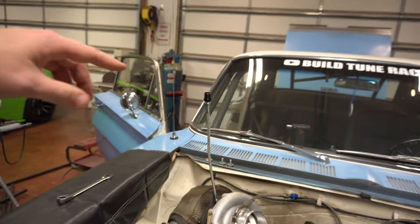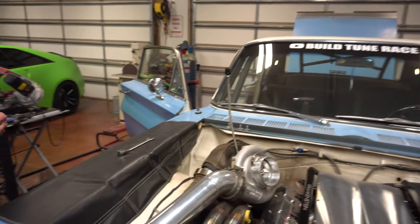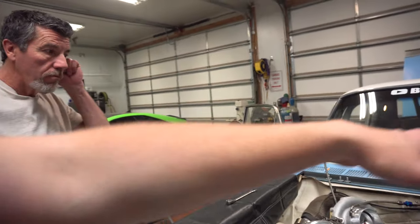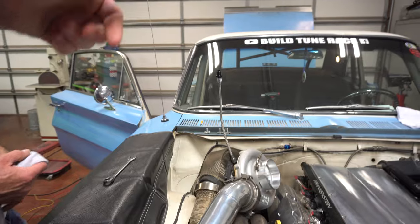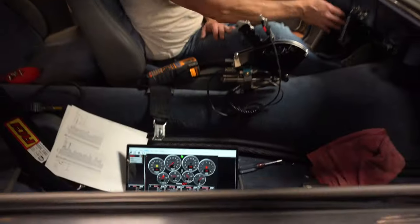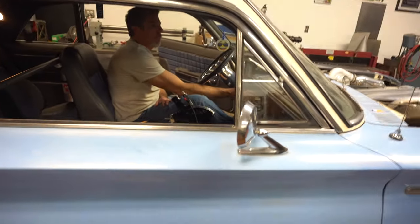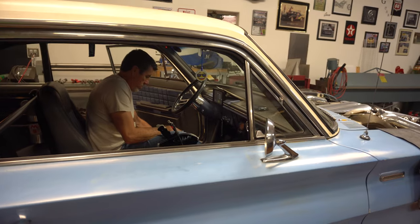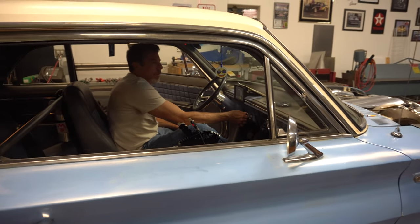I was wondering what the lines were that he had on here. He set these up to fill it up with some oil so you weren't dry running the scavenge pump when we first fired, when we were testing it right there. So he just slowly put some oil in it so at least we weren't dry running the scavenge pump. We're gonna fire this thing up and hopefully verify that that pump works. It doesn't make a lot of vibration, but we'll try to feel it, and I kind of got an idea what it feels like when it's running.